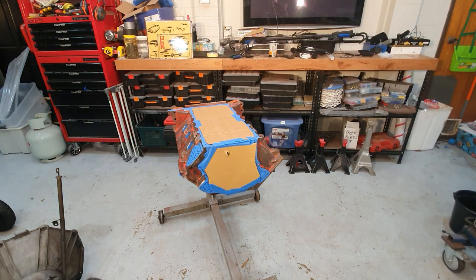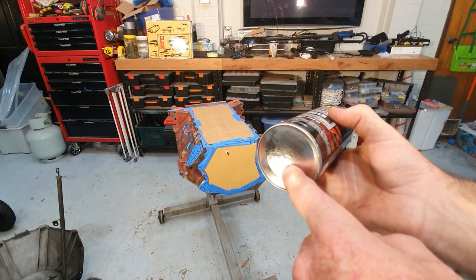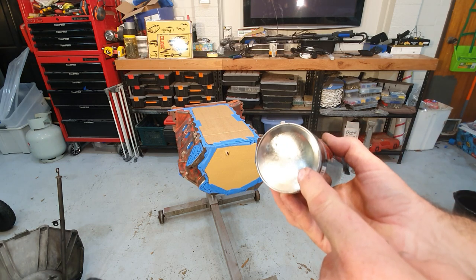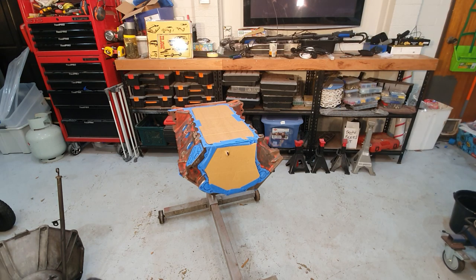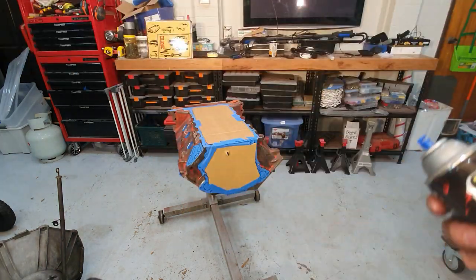One thing that's pretty important when you're painting with pressure pack cans, I'm not sure if you can see that, but if you look underneath this can, see all those dints in there? It's kind of like internal hull damage to this can. If you don't have those dints in the bottom of the can, you have paint sitting on the bottom and you haven't shaken that can enough, and you've got to go back and keep shaking it and getting it ready for the paint. So I've done that before because I've already primed that sump over there earlier on today.